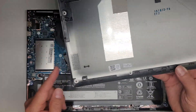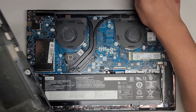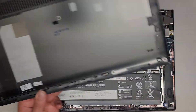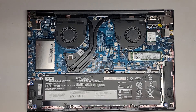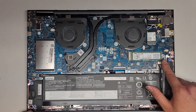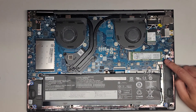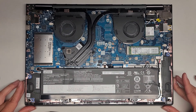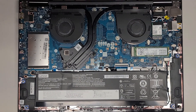You can see it's pretty dusty and dirty in here. The fans pull air in and blow air out the back, and you have vent holes as well as the speaker grill — that's actually getting dust into it. You've got a M.2 PCIe NVMe SSD here. There's a warranty sticker there so I'm not going to take it out, but most likely it has a PH-1 or JIS-1 screw under there. Let me zoom in a little bit to get a closer view.